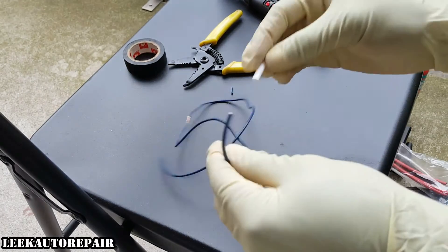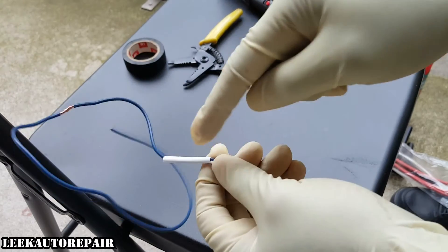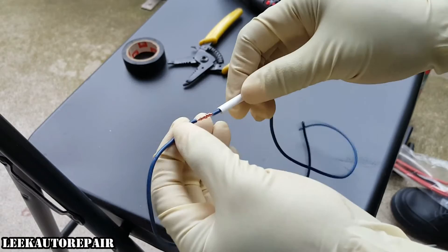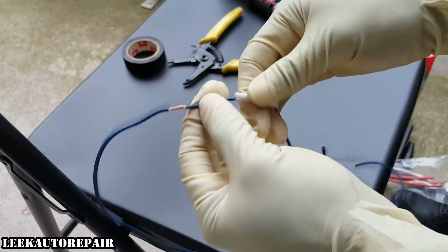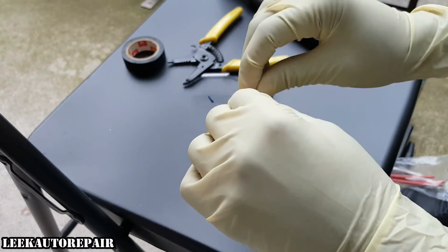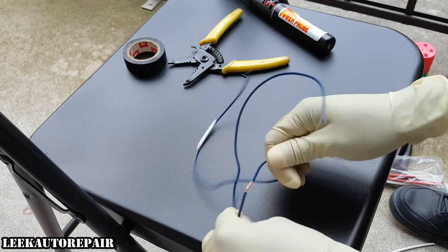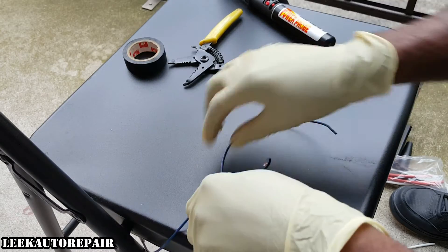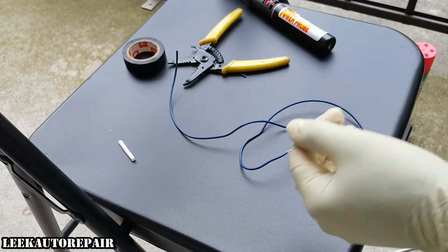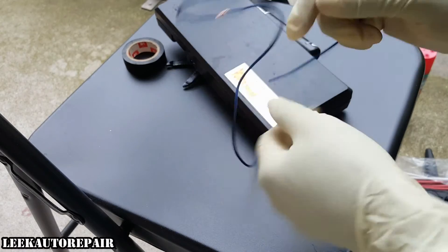Now I'm going to loop it through. When you're doing wire repairs it's best to thread the heat shrink through as soon as you can, because one end may be sealed off and you won't be able to get it through later — but at least this way we got one open end to fish it through. It may come apart a little bit. Once you get it like that, I like to set my wire up somewhere stable to make my life a lot easier. Alright, so I got my heat shrink and the wires twisted together.